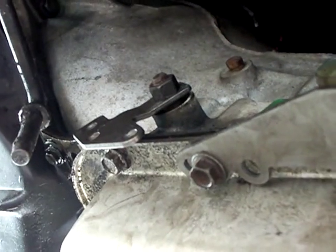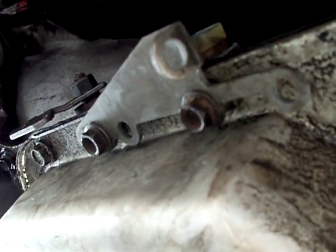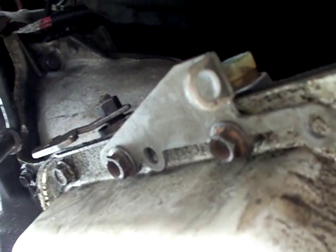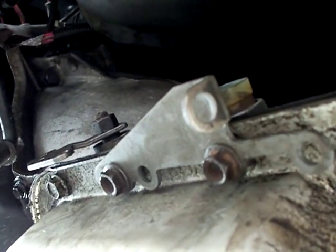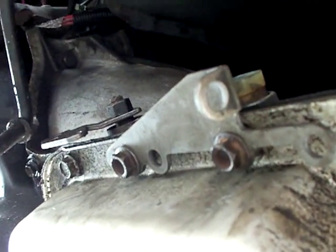And you can see, again, the front bracket mounted. Again, note the different bolts. I used longer ones. I feel much more secure with that because, like I said, I pulled some threads out trying to put the back bolt in, just because of the way you have to mount a spacer to get around the flange of the transmission pan.